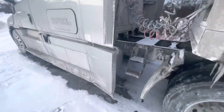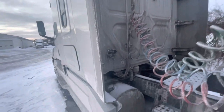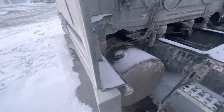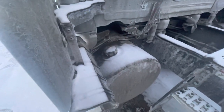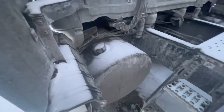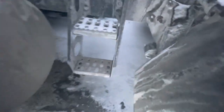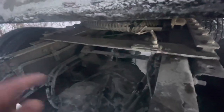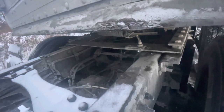Back behind the cab, no apparent damage to the back of my cab. My fuel tank is secured with metal straps, also not leaking. My fuel cap is secured, not damaged — secured with a rubber ring and a metal chain. My frame has no cracks, bends, or illegal welds. In between the frame, I have a drive shaft, which is secured, not damaged, not bent or broken. Right here, you're going to see a bar that goes horizontal — that is a stabilizer bar, secured, not damaged, not bent or broken.